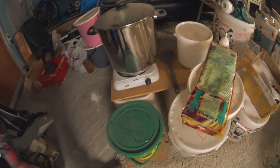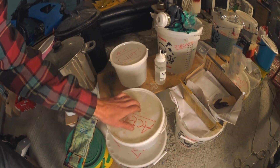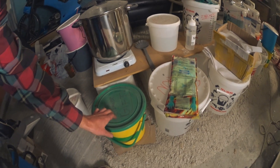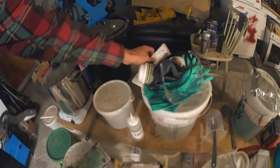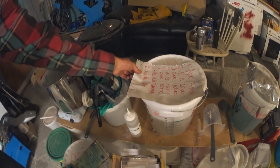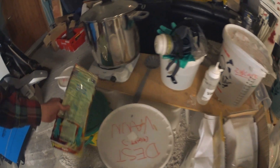I'll show you my plating setup. Here is the first step — actually this is the first step. Acetone. Start by cleaning the castings inside in the kitchen sink with normal detergent, get it as clean as possible. Then do a dip in acetone. Then I heat up this alkaline cleaning solution in this heater and do a dip there. Alkaline cleaner — five minutes. Then rinse in distilled water.